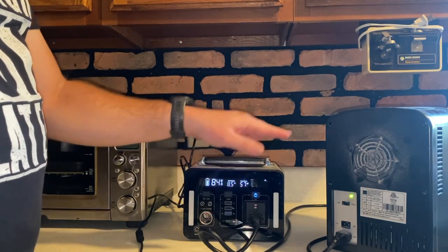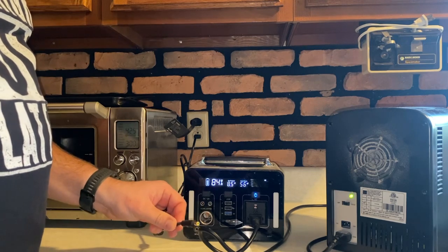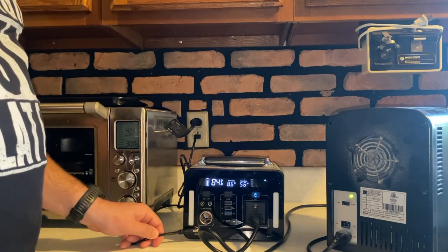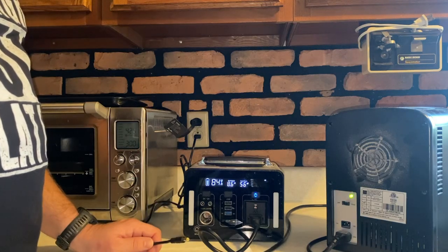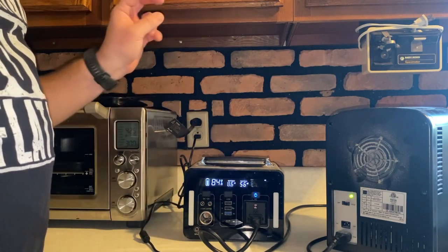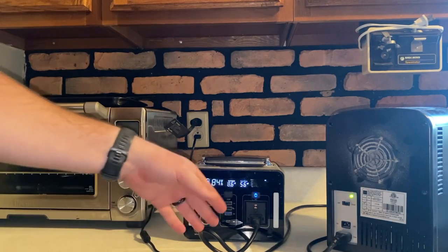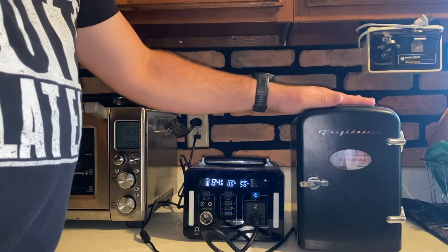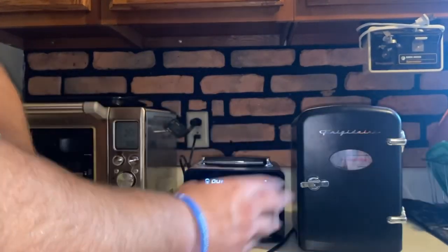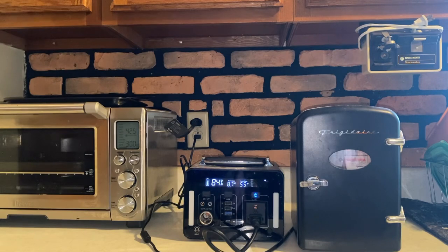If the inverter is working, you can just run it like usual and plug directly into the 120. This one I have is the 5 millimeter, but the 8 millimeter input — between one of the two, depending on your inverter — you can always check the spec sheet depending on which portable power pack you buy and where you buy it. You can use that adapter also to charge these up with a photovoltaic module. So you've got two backups from the power source and two ways to power, which is really great. For those that have to have life-saving medical supplies every day, that is an easy, simple fallback, and you're not trying to power up a large, regular refrigerator — just something very simple, easy to use, and low demand.